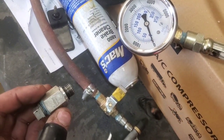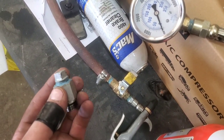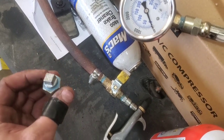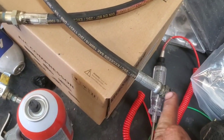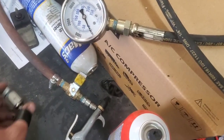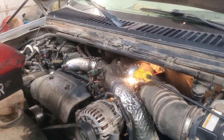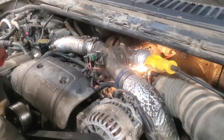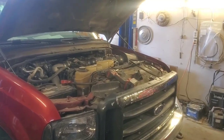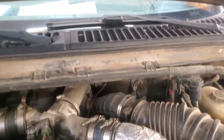This fitting here is a number six o-ring boss to three-eighths pipe that just plugs off. You plumb one side into the high pressure oil pump, plug the other side off to deadhead it. While doing that you have to full-field the IPR to get it to close, or else you won't get a correct reading. Let's go ahead and install this setup on a known-good pickup so I can show you exactly what a reading looks like on a good one.